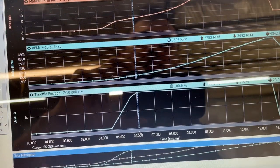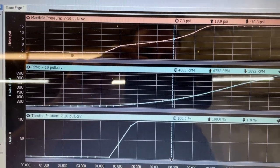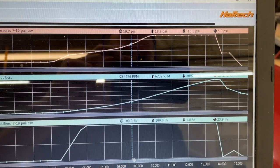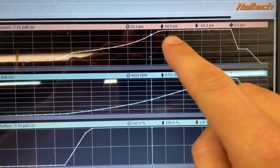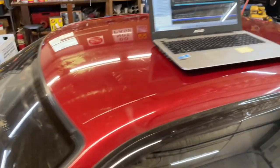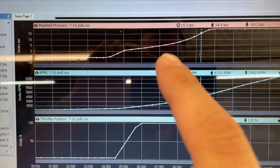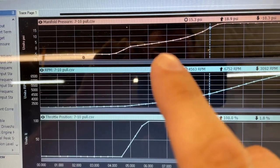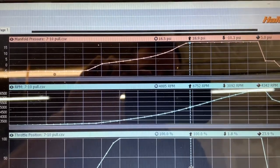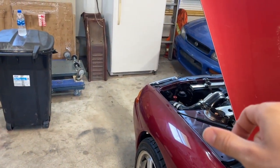Let's go forward another 500 RPMs to 4,000. Now we're at 7 PSI, still at 100% throttle. At 4,500 RPMs we're still not at peak boost — peak boost is 18.9 PSI. I have a manual boost controller and I'd like to hit 20 PSI, so I'll turn that in a little bit. I already sent this log to my tuner and I'm waiting on his feedback. At 4,500 RPMs we doubled our PSI — from 7 to past 14, so we're at 15 — still at 100% wide-open throttle.